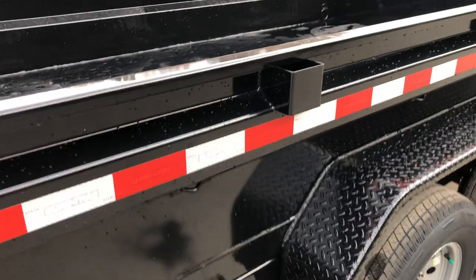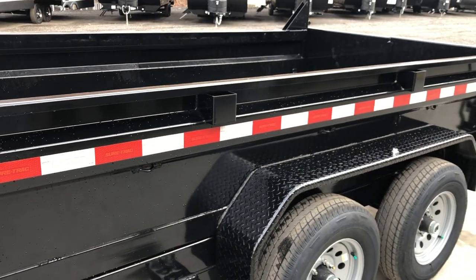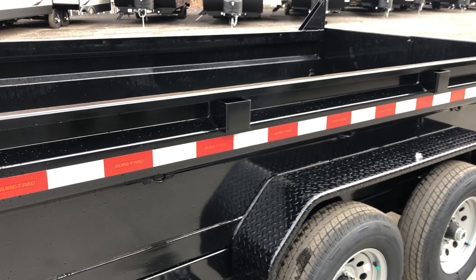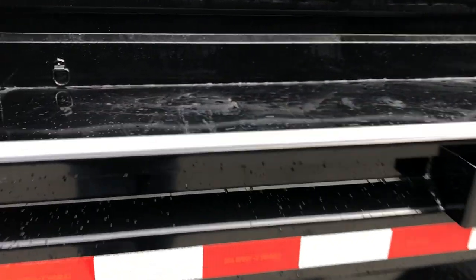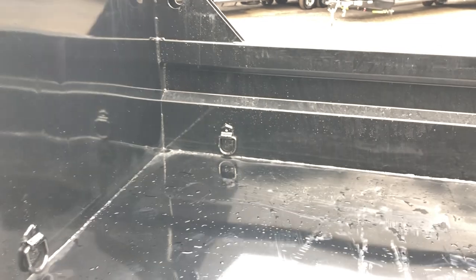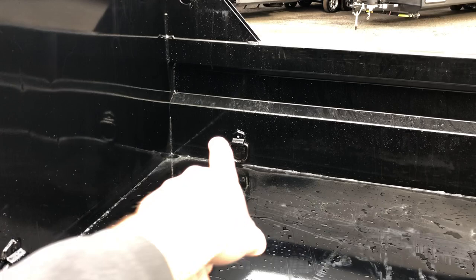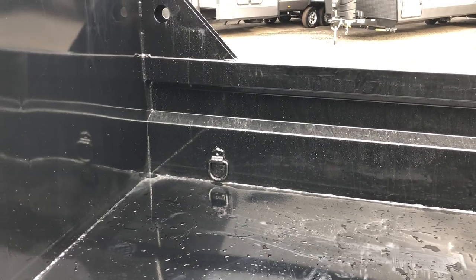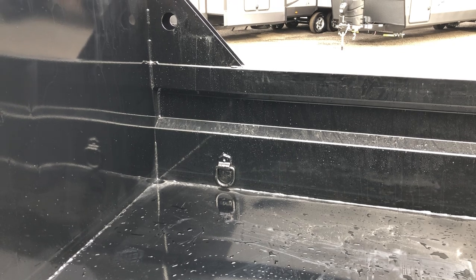Another benefit to the Short Track is that the keyway in the sidewall adds a ton of strength to this trailer without really adding a whole lot of additional weight, giving you the highest available payload while making the strongest available trailer. On this particular unit it is fully seam-welded — a lot of manufacturers will stitch-weld. That's full seam along the perimeter. The D-rings are also up off the floor and out of the way, with a fifth D-ring up front if you want to use a come-along.